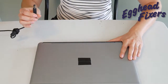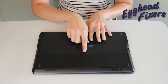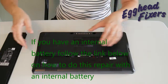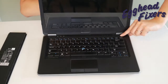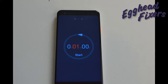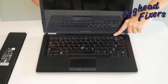Now first of all, we're going to have you unplug your power cord and take out your battery. This is a procedure that often times when you call into warranty repair from your manufacturer or an IT support line, they'll have you do, because it's just that effective. Once the battery is out and the power cord is unplugged, you're going to hold down your power button for one whole minute. After that one whole minute is up, go ahead and release your power button. What this does is release any sort of build-up in the system that could be preventing your computer from working properly.